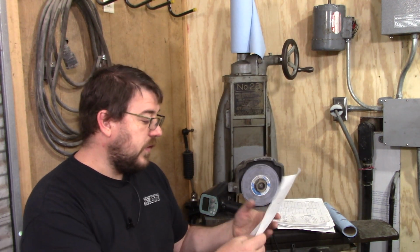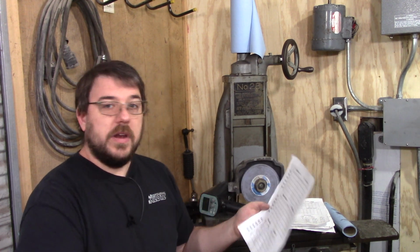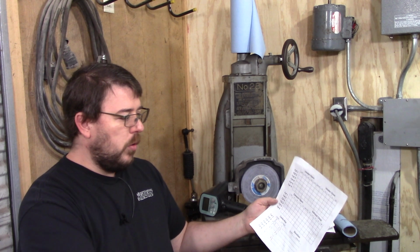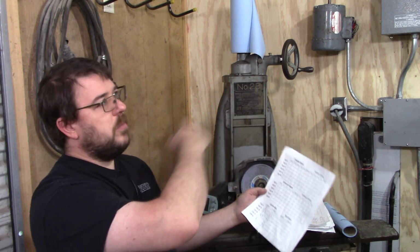And conveniently, by the error being on bank 2, we can eliminate the possibility of chain stretch. First of all, this motor is a 4,000 mile motor, so chain stretch is unlikely, but the motor pulls, it goes from the crank to bank 2 and then to bank 1.